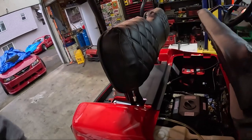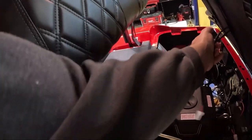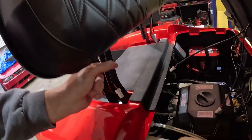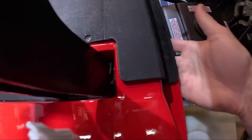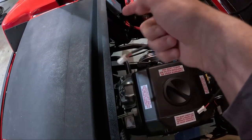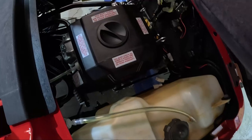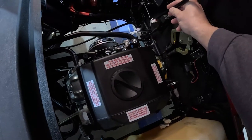It's the next day and we have to get back to work. First thing we're gonna do is extend the seat heater lines — we have four of them to do, left and right, front and back. These are gonna get snipped roughly right about there and then ran down through there, through the bottom, and then plug in there. Same with that one — run down across, plug in there. These ones are just gonna get extended and go straight down to there. Shouldn't be too bad.